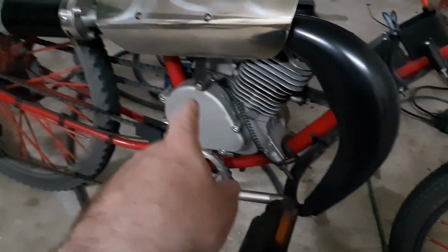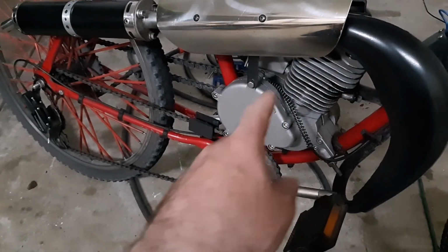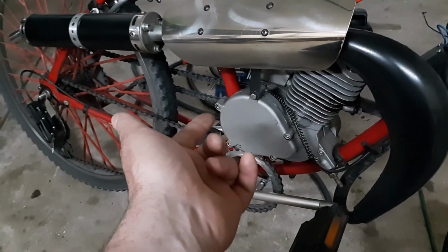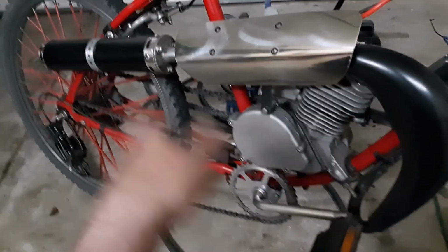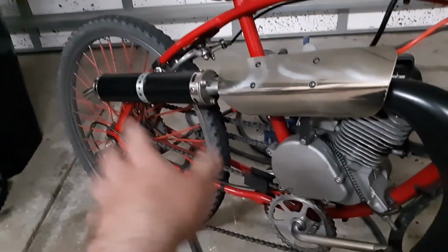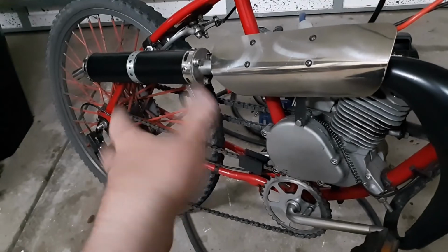And then I have a 10-tooth gear to a 40-tooth sprocket on this. So actually, the motor at 10,000 RPM would be like 660 RPM coming out from that 15 to 1 ratio. And then, you know, 10 to 4, you divide that by 4. And then you would take your tire's diameter, do all that, and you could actually figure out how fast this would go. And this bike with all this as is, wide open, will do about 38 miles an hour, something in that area.